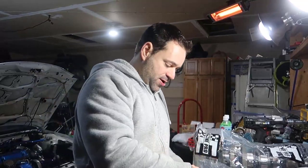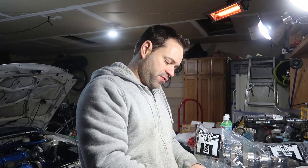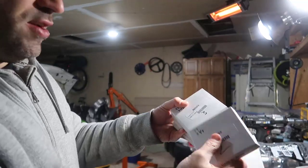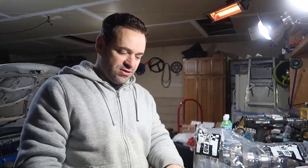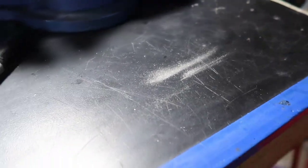It's 3 a.m. and all the rings are gapped. Cylinder number six is 0.022/0.024 tight. I wrote the cylinder number on each ring's box since each cylinder could have a slightly different bore size. This is gapping done properly - you can see how little material is actually removed.